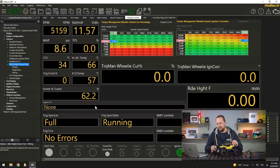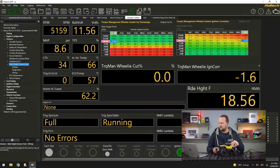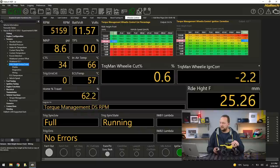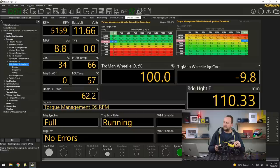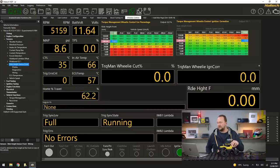Let's get our pretend drag car and start lifting the front end. In the software we can see: lifted 2, 3, 10 mil, 20 mil — nothing's happened yet, it's pulled nearly two degrees of ignition timing. Then it drops 2, 3, 5, 10%, 15%, 20% cut — all the way up high — and then suddenly, 100% cut, meaning no spark at all. Then it drops back down, no cut, and full power again.